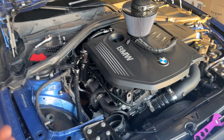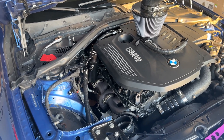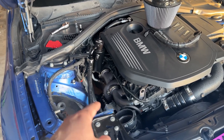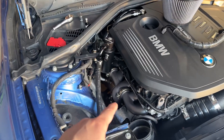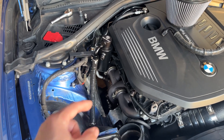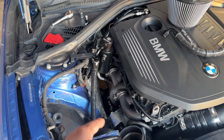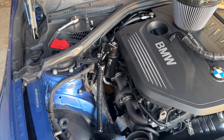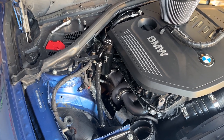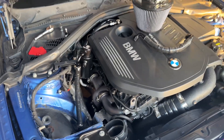I hope this helps you guys if you have any kind of wastegate codes — whether it's too short, too long, or wastegate closed — because it's definitely related to your wastegate. This is not a failed unit; it would tell me if it was. All it was was the jam nut being a little loose, causing it to jam up. Any kind of resistance on the wastegate is going to put you into some kind of limp mode or safe mode, preventing you from getting into boost. If you have any questions, please let me know — thank you for watching.